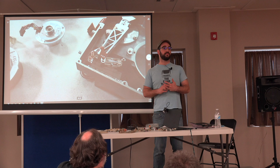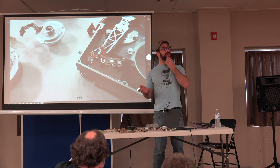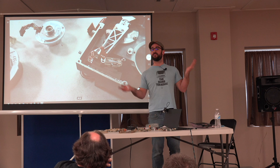Yeah, the problem is knowing, what do I have, and most model numbers. Look up the model numbers of the cards, and if you can't find that, find some of the bigger chips and see if you can find a data sheet on them. Maybe there's something like, oh, this is a dedicated ESDI controller or something.